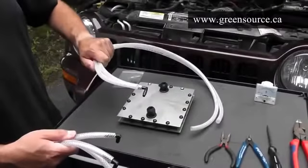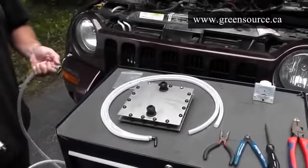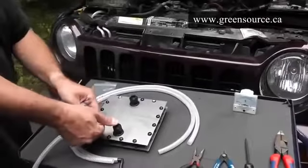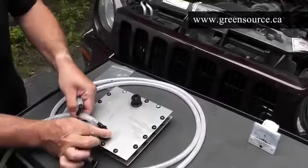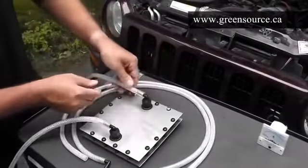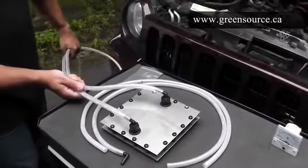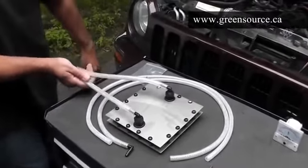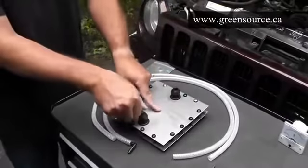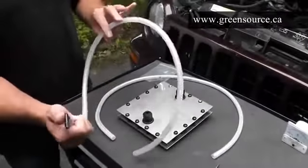They spin down very easily at first until you feel a little bit of resistance, then stop. You have an upper and lower hose that'll go to your reservoir, but we're going to show you a little trick today. You can install the whole piece of tubing at one time. The connectors simply push in and rotate slightly, then it's in place — just another half turn with your fingers, finger-tight, no tools, until it's firm and doesn't rotate easily. One common mistake people make in an installation is routing of the hoses incorrectly, and most critical is the upper hose.